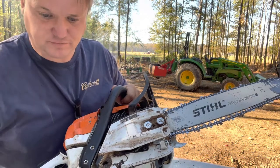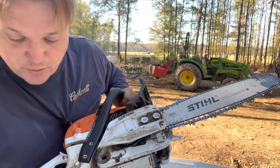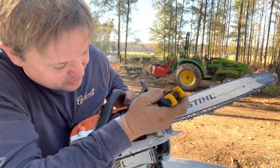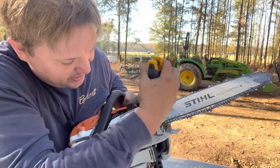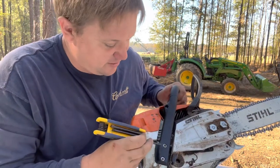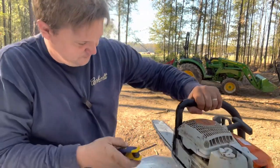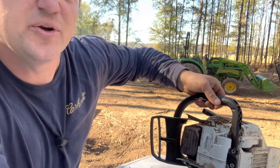There are six bolts that you've got to pull off. This one is hidden — you won't understand why for the moment — but go ahead and unscrew this one so you can see the most difficult part of getting the old handle off your saw. Then you've got these two screws, which are obvious, you'll notice them very easily. And you've also got these two right there.